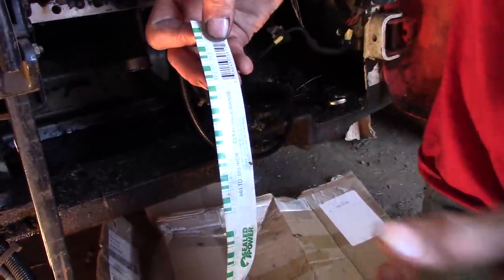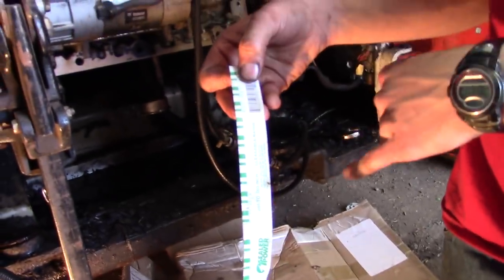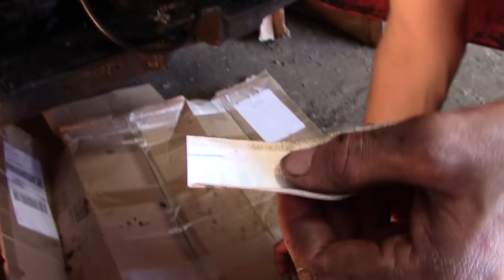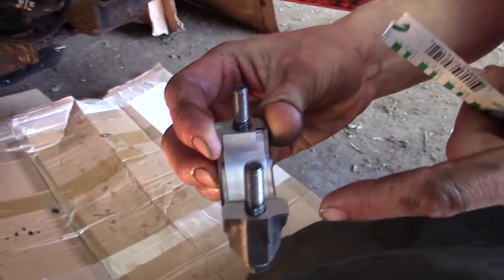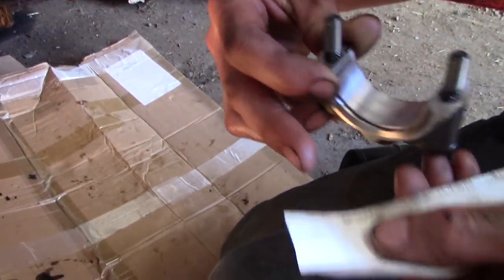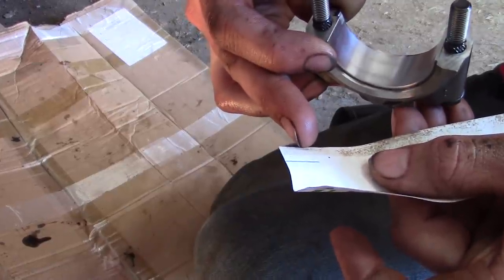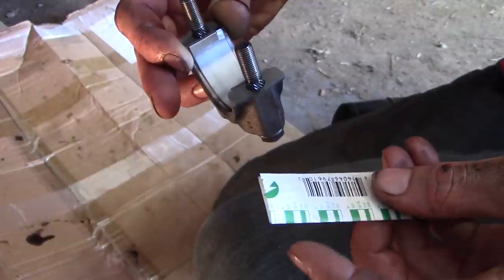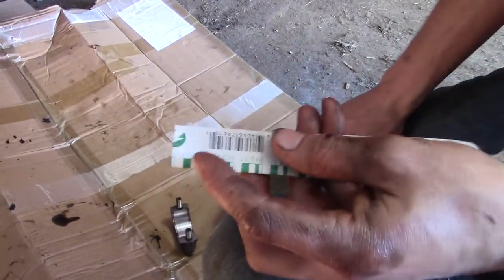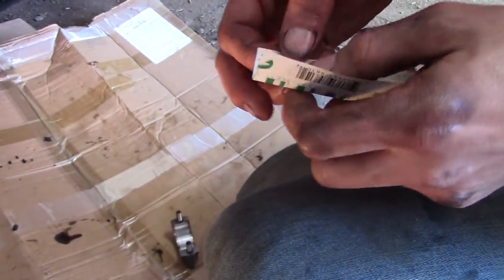The green stuff — I'm assuming green is standard across the brand — is for speccing between one thousandths and three thousandths, which is actually directly what this engine requires. I've got a little piece of it here. The crank journal is dry and this is all dry, so I'm going to put this little piece on that. Then we're going to bolt that up there and torque this cap to the proper specs, which is 36 foot-pounds for this engine. Then we're going to take the cap back off and see how far this PlastiGauge squished out. Using these lines here, it'll tell us the tolerance of the crankshaft journal.